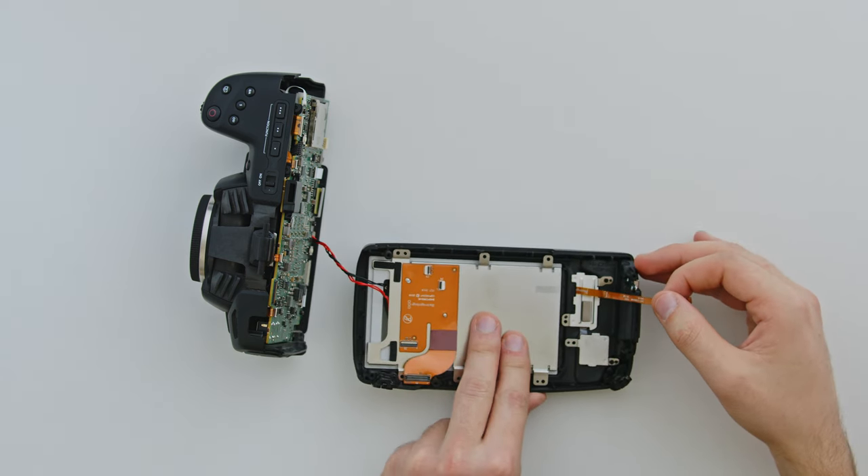Place the camera onto its front. Take the V-mount plate and insert the V-locking part — release button through the hole on an angle like this, before it should slot into its place. Gently thread the power input connector through this gap — remember not to pull this cable too hard, or it could disconnect from its connection inside the camera. Before inserting the power connector into its slot, take the black plastic panel included with the mod kit, and with this side facing out and the ridge end facing down into the camera, it should slot into the bottom of the gap in the metal plate. The battery contact pins should then slot into the gap alongside it. We're now going to use the bottom left five bolts from the mod kit — these five bolts go into these holes. Once tightened down, they clamp this V-mount panel to the aluminium plate inside the camera, which makes the V-mount extremely secure.